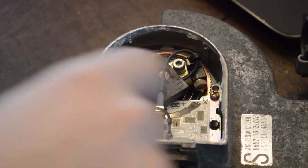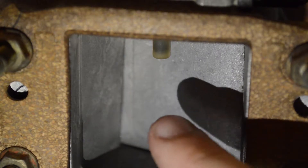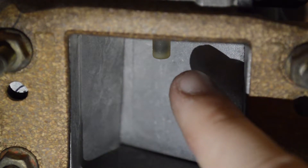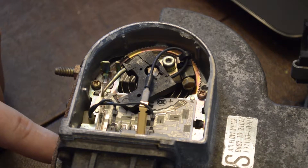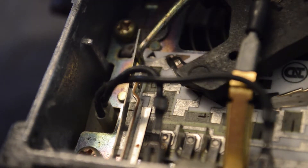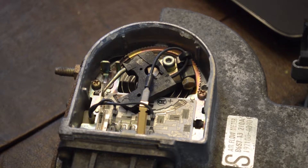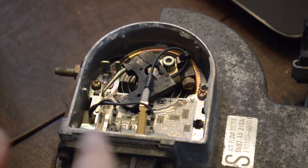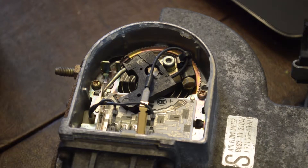The other pins do different things. Pins 3 and 7 — you can see right here — there is an intake air temperature sensor. And then the next part, which I will get b-roll of, is the fuel pump cut. Basically, this little arm pushes the first pin's flapper arm away from the second pin's resting arm, and that disengages the fuel pump so it doesn't run while the car's off or in the key-on position when it's not started. Once the car starts, it turns on the fuel pump. Pins 3, 4, and 5 are connected to the actual board and receive the signal of where the flap is.